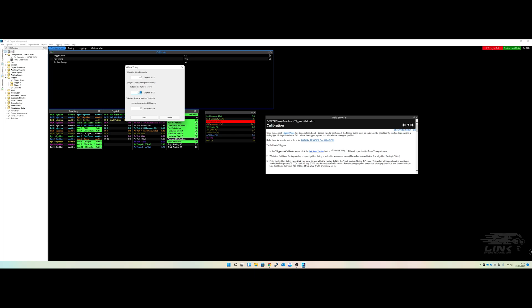You adjust the offset number until your timing matches what you've set. The third option is used once the engine is actually running — at higher RPM things happen faster and timing can drift. What we're going to do now is crank it over by hand, check that we've got 10 degrees, then start it up and rev to about 3,000 RPM to confirm the mark stays consistently in place. There will be two steps: one cranking with injectors unplugged, then running.